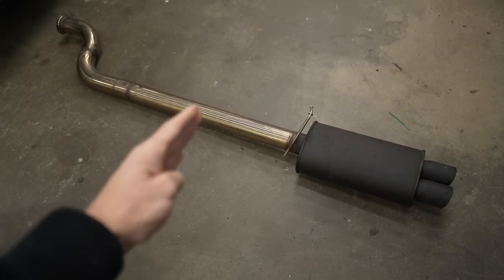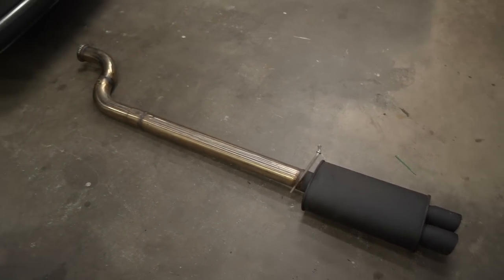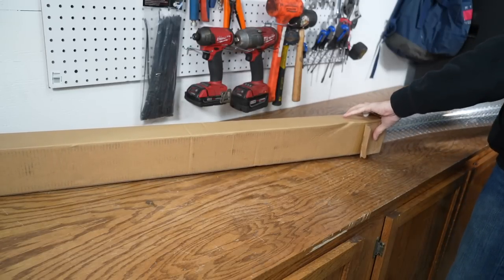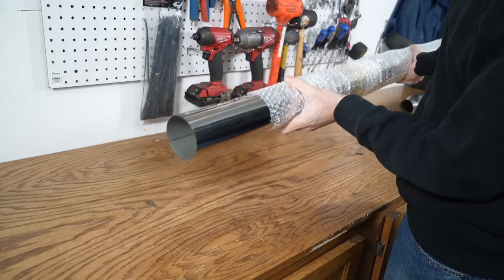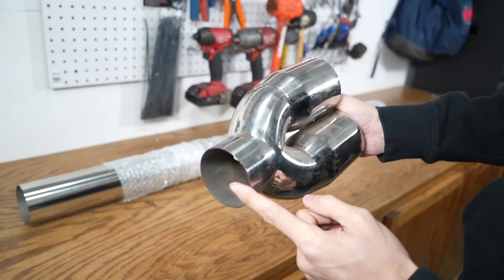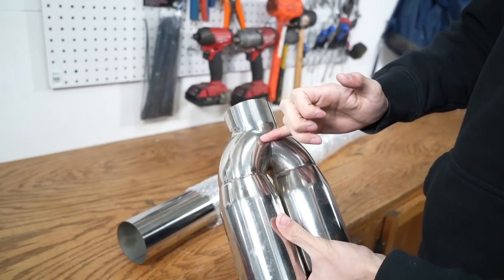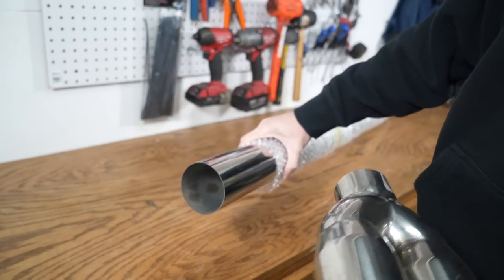That is not something I want hovering over my mind. So I want to cut this pipe right there, put a v-band in, and then make another section so I can easily put the muffler back on or take the muffler off. What I have here is some 3-inch stainless piping - I got this off Amazon. I also have this exhaust tip I've had for probably three years, but it's a two-and-a-half inch because I got it when my car was NA. Now that this is a three inch, I want to use an angle grinder to cut it down, hammer the pipe on both ends to clamp it around, and then weld around that to make my own three-inch inlet exhaust tip.